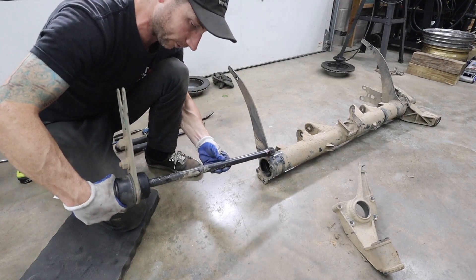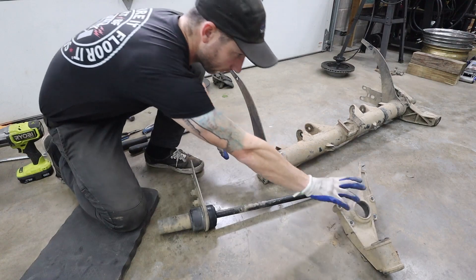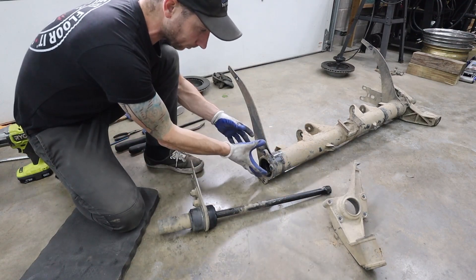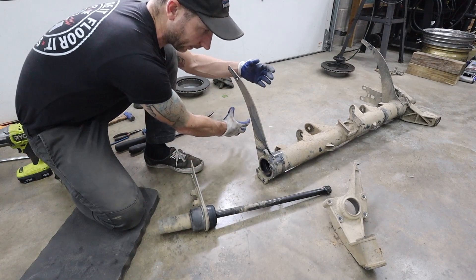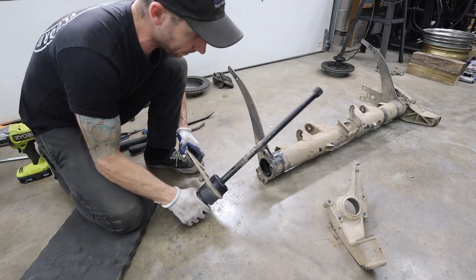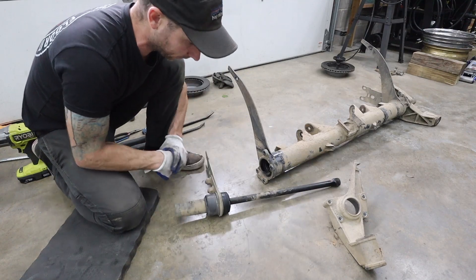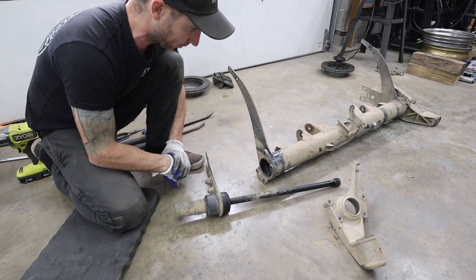But even if we go to coilovers and bagging this car doesn't work out, we're taking this torsion bar out altogether. Then we'll put the early spring plate on, then the bracket which acts as the end cap, so there's nothing in there. Where the shock mounts, there'll be a coilover or an airbag — that's what now keeps the car up. This can be used as added spring, but I'm not going to deal with that at all. We're basically going to reassemble with the early spring plate.